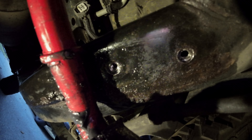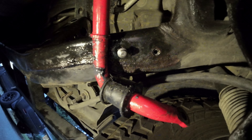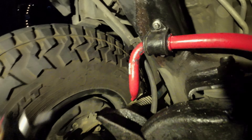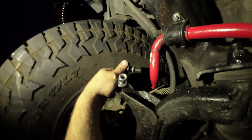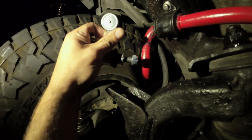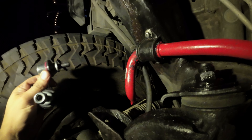I dropped the helicoil in there, and the ultimate test will be to see if my M8 by 1.25 bolt works. That's what I'm talking about — now we can really torque this bad boy down. We got the sway bar mounted with my helicoils. That was a pain in the ass — every step of this has been a pain in the ass. But now it's time to throw in the end links. We got brand new ones because we chopped up the old ones, and that should make the car ride a lot better. Hoping these bolts hold, but we'll see.